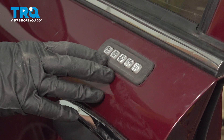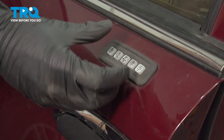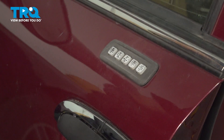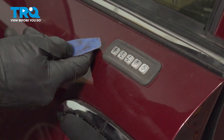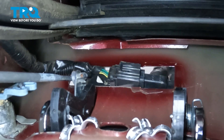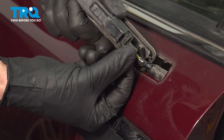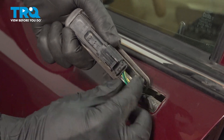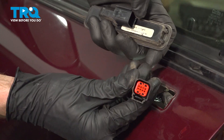Make your way to the outside of the door. We're going to carefully try to grab onto this and gently pull it off and away from the door, starting from the left side and rolling it up and out. We do still have wiring attached to the inside of this. You can either use a trim tool or carefully use a small screwdriver. Along the backside, you can continue on to removing the electrical connector by squeezing in on this tab and gently pulling it off.